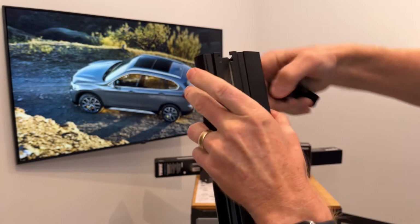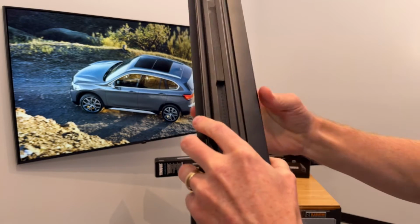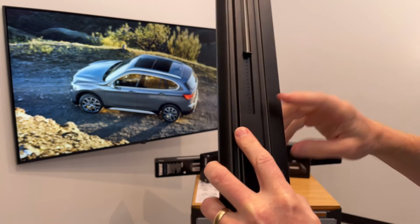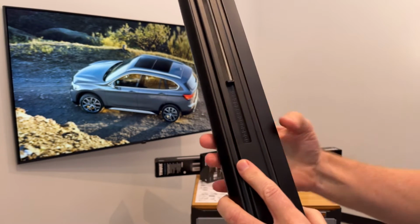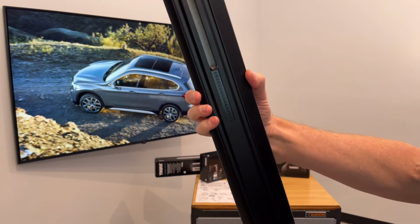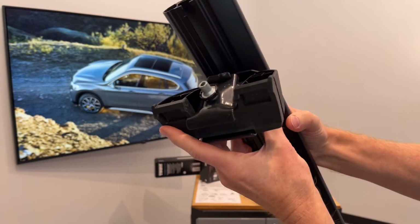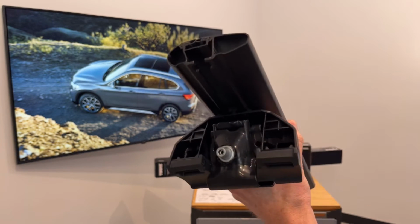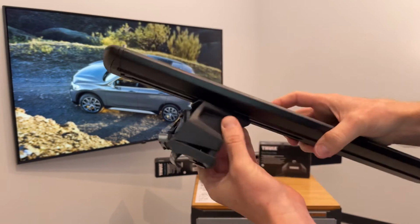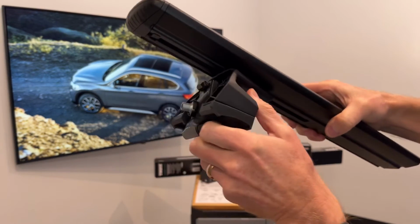Now we'll take off the end cap, and now you can see there is another slot on the underside of the bar. And within that slot is a measuring device. The measuring device has numbers. Now those numbers are not referenced in the instruction manual for this particular application. However, they can be used to help to manually center the load bars on the roof of the vehicle. Now we'll go ahead and slide the foot into the slot on the underside of the bar, and we'll go ahead and put the end cap back into place. That's a safety measure so that when you're maneuvering the load bars with loose feet around on the vehicle, they won't slide off the end of the bar.